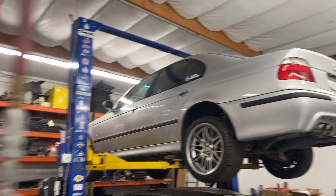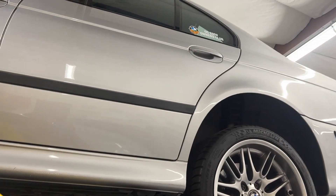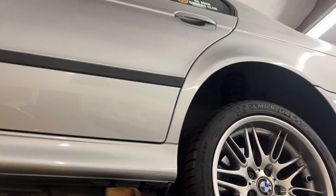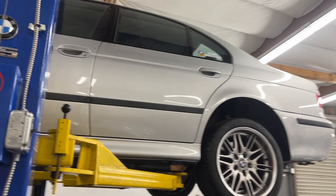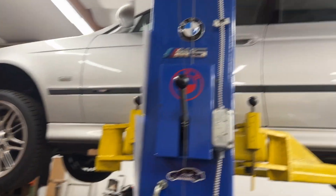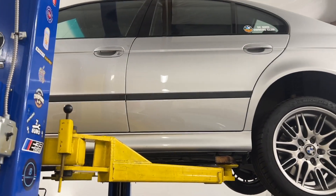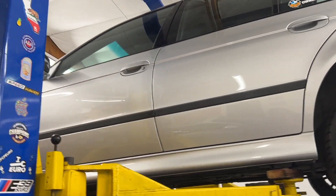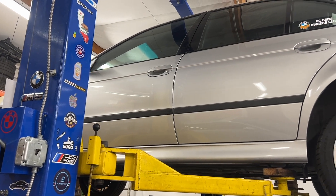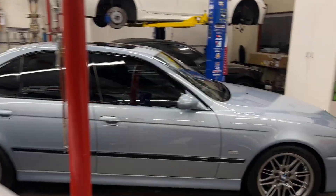I learned something today: on cars that have rear airbags — such as mine and this car — there's a sticker on the pillar showing they have rear airbags, and an orange sticker showing they're not operational. If you code the module to say no rear airbags, you get a warning light — the airbag light comes back on because it knows it's supposed to have them coded on, even though they're unplugged. Once I checked the boxes for rear airbags and turned those ignition circuits on, the light went away and is staying off. Pro tip.